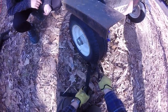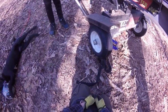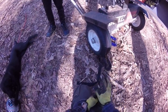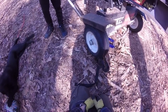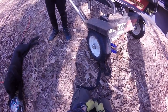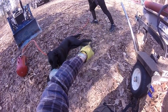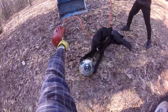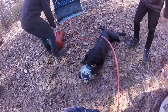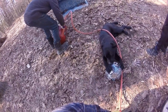We don't want to overtighten this. Like I said, as soon as you put pressure on there, that strap is going to be under a tremendous amount of tension, and it's a little bit dangerous. So you want to put just enough in there to start it to seal. And as soon as you hear the air go in the tire and it starts to seal, you'll start backing off this ratchet to minimize the chances of that breaking. So let's go ahead and put a little bit of air in it. There's a valve on the side, Simon, that red plastic handle. You've got to open that counterclockwise. Keep turning it until it stops.